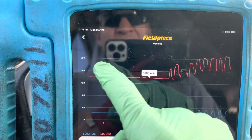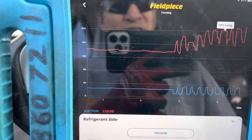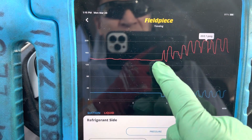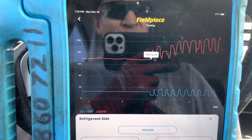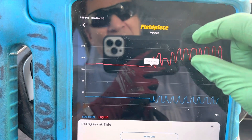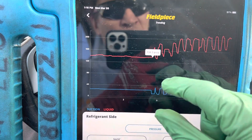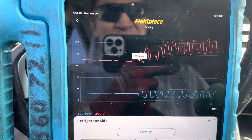It's going over 200 psi now. I have it over 2000 RPMs. The hood is up and my pressure transducers are connected. As soon as I went from idle to over 2000 RPMs, you can see that the high side upper and lower limits are gradually climbing, but the low side has not moved a bit. It cycles but it's not gradually climbing with the high side — the low side is staying low.